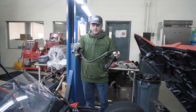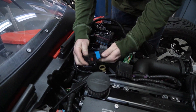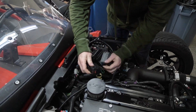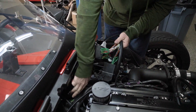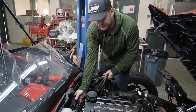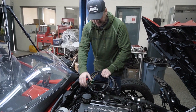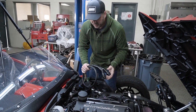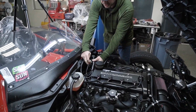The next part, we're going to plug in the plug-and-play harness from Haltech. These are color-coded, so you're just going to put the blue with the blue, the gray with the gray, and the black with the black. Once these are all in there, you're going to give this one little twist and get these down inside your transmission tunnel. Once you get these down in there, tuck it down, go underneath the Slingshot, and put a zip tie around this and secure it to the bottom of the hard fuel line which is going through the trans tunnel as well, just to hold everything in place. Once you have all that in there, you'll want to end up with your connectors right about in this area, and just leave them off to the side for right now.